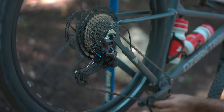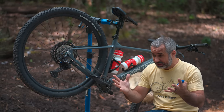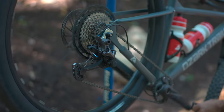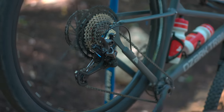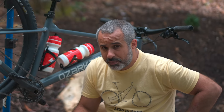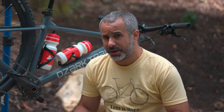So you've learned a thing or two. Now you're working on your derailleur and you have it shifting more or less perfectly. But if you go too low on the cassette or too high on the cassette, it just starts to skip all over the place. What's going on? You probably have a bent derailleur hanger, and you can check that with a visual inspection.